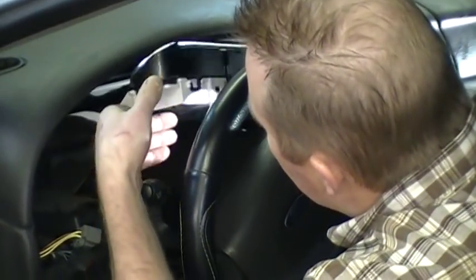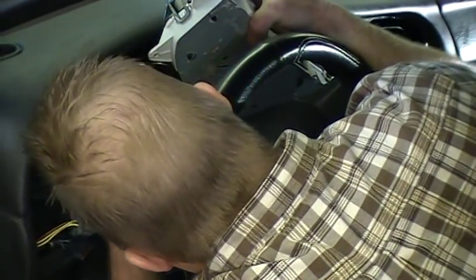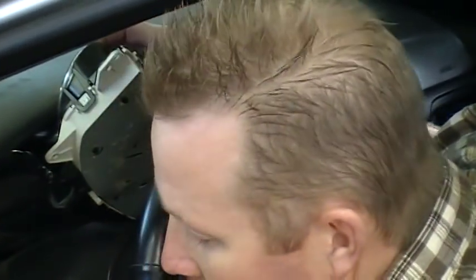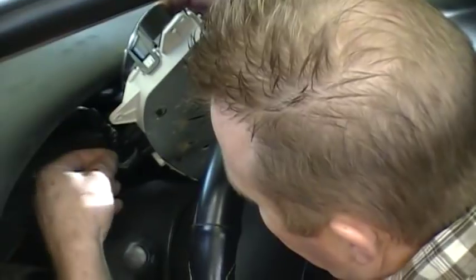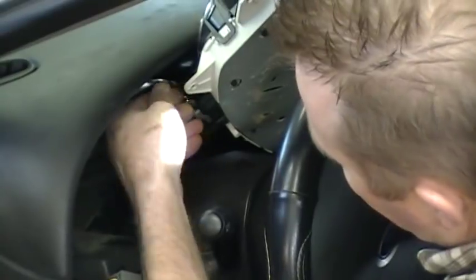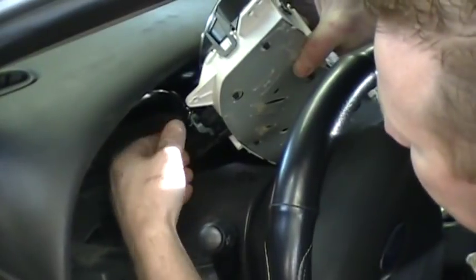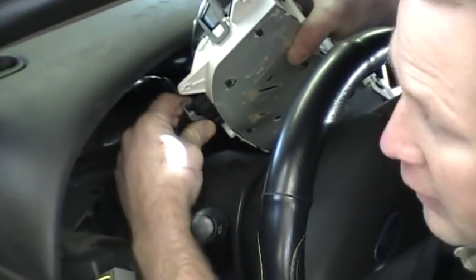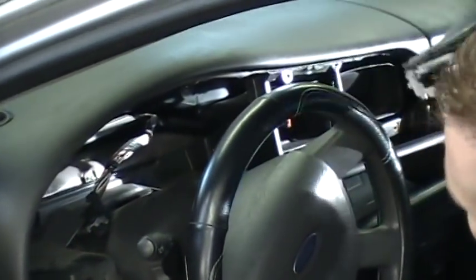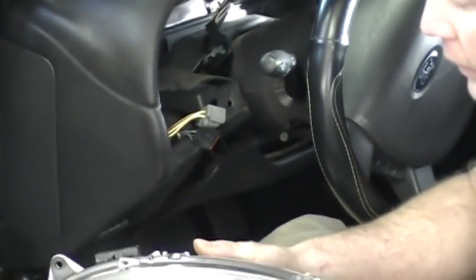And once you do that, you got your connector. I like to unplug it with the key off. And the connector has a little locking tab as well. You push with your finger or use a little screwdriver and push it while you're flipping this gray lever back. So you'll push that, you'll flip the gray lever back, and that pulls the connector out for you. So same thing going back in. You'll put the connector in place, you'll flip it over and lock it in place. You hear it snap lock in place. You want to make sure it's fully seated. But once you flip it over like that, the cluster comes out and you got it in your hand, so you can send it in for repair.